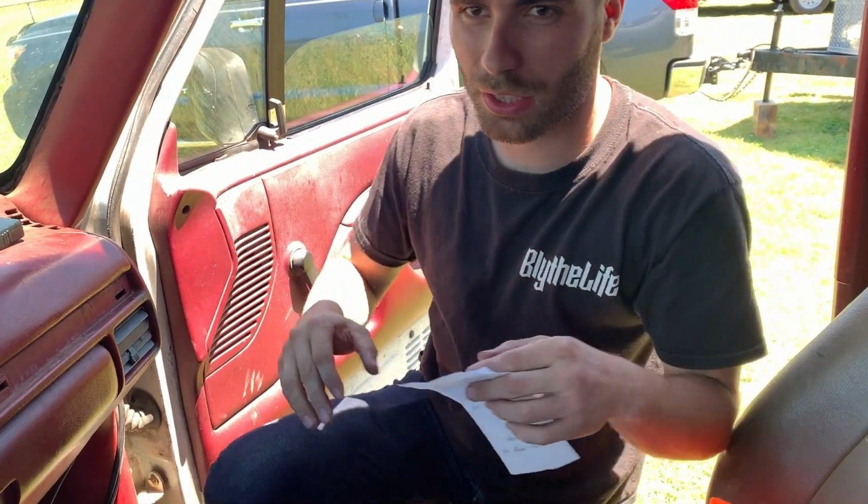The new motor. It's a 1.36 60 foot. 330 was a 4.1, and the 8th was a 6.3 at 115. It started pulling right off the launch a little bit, picked up the tires and pulled to the right just a hair. I might put a little bit of rebound in it to slow it down a little bit more, and I think I might put a flat of preload in it, and see if I can start getting it to steer to the left a little bit. Besides that, I gotta work on my shifting because I'm not even getting to rev limiter.